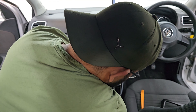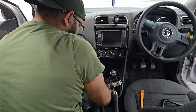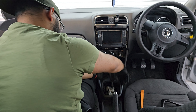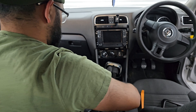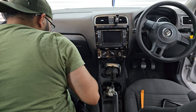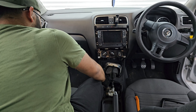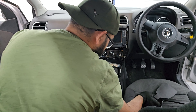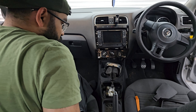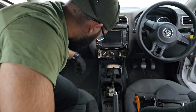To do the rest of it properly I need to dismantle the center piece and slide it forward. Back over here by the gear shifter it looks like there are two tabs that you need to pull downwards, one on each side — that's super awkward. There we go, lift this out. From here, a couple more T20s. I hope you like these videos because honestly it's a lot of work — filming all of this just takes so much longer than it would if I didn't have to film. Next, you take off the rear cup holder section.